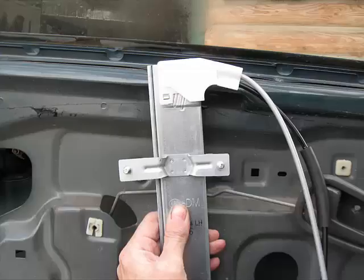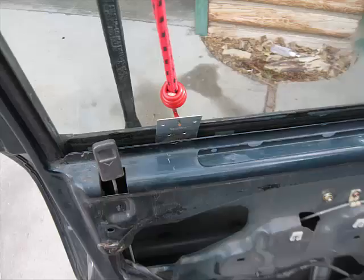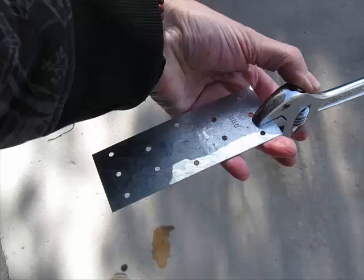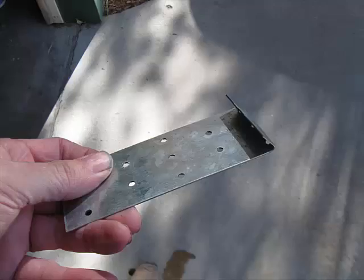Once we had that done, we had to get the glass out of the way. I came up with an interesting little trick — you see here this bracket. You can get these joining brackets at any hardware store; they're mainly used for joining wood together, but you can actually bend them in such a way that it grabs onto the bottom of the glass. Then just hook a bungee cord to one end and swing it over the top of the door down to the door handle, and it will hold the glass out of the way so you can work without worrying about it coming down on your hand — because I had that happen a couple of times and it's not very comfortable.